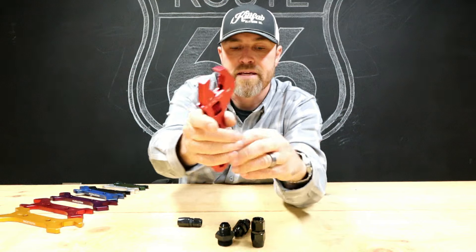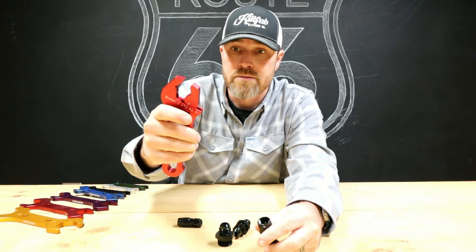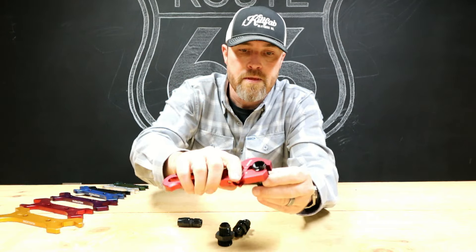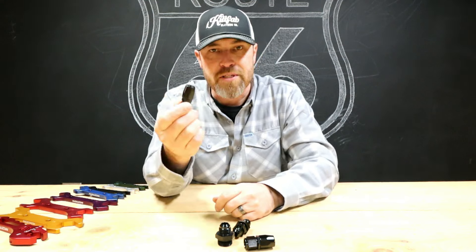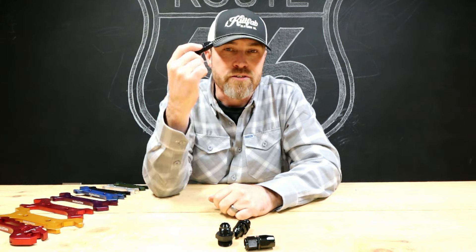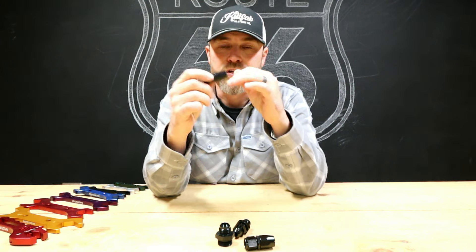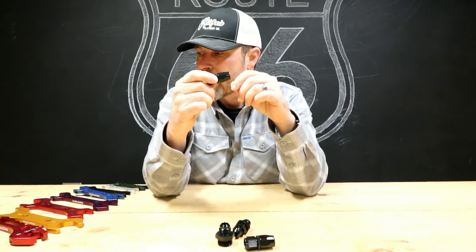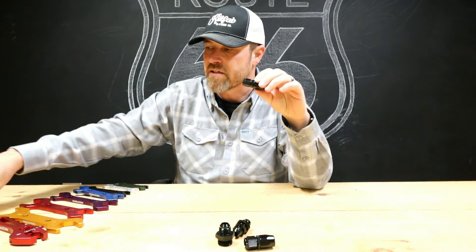So if you're using a — that'd be like a 10 there. Let's see if it matches — we'll go to 8. Oh yeah, perfect. So like I said, when doing these fuel lines, trans lines, really anything with these aluminum AN fittings, you really need these tools. Otherwise you're going to mess up the actual fittings themselves.